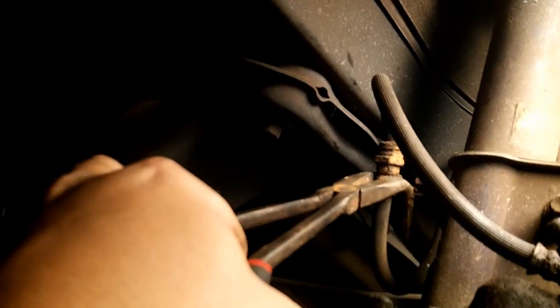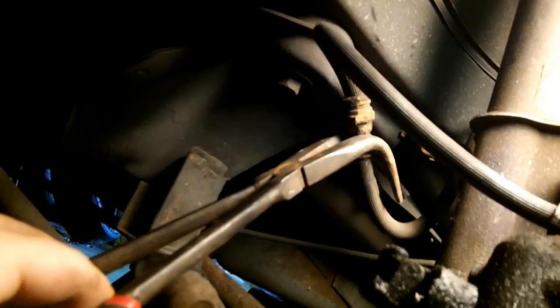Now this line should just come out, but if it's rusted in place, it's not going to come quietly. That is rusted in place. I'm just banging on the outside of this — I'm not banging where the clip resides. I just want to try and knock some of this rust off, and I'm not actually hitting on the brake line. I went in this direction, grabbed the bottom of it, twisted it back and forth, and it broke all that rust free.